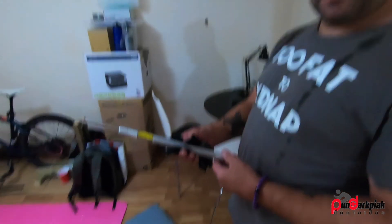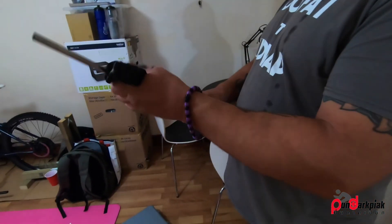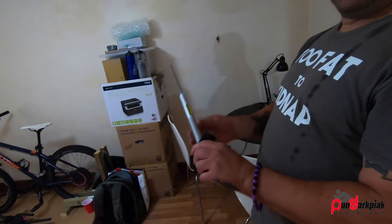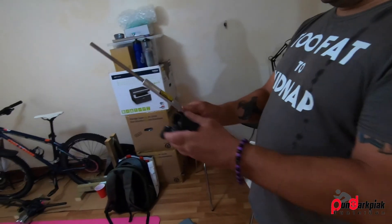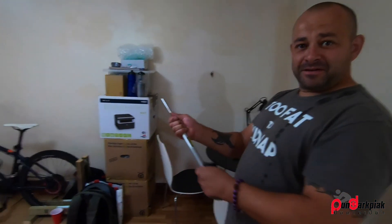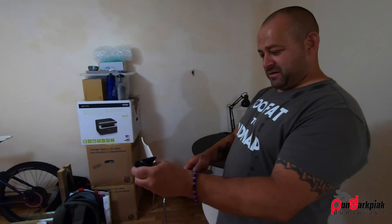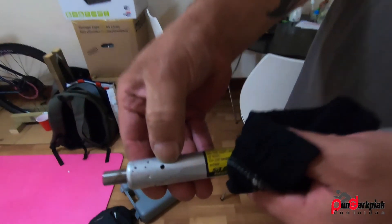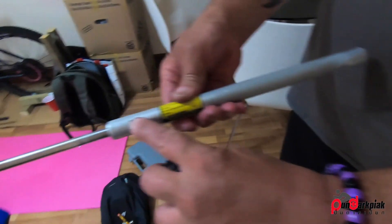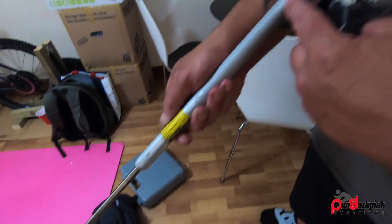Today's home edition of home mechanic DIY by Pete. We're trying to fix a problem with my damper — SR Suntour Raidon. Basically it couldn't travel the full travel. It's got a nitrogen cartridge and it failed — it's acting like an incompressible fluid; it's got a hydraulic block, sucked all the fluid in and gone solid. So we drained pretty much a few syringes of oil, drilled it out, and released the pressure — drilled at the bottom of the leg. So when the damper compresses, it will push oil into the system.